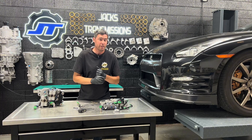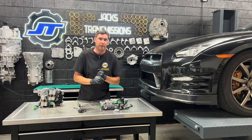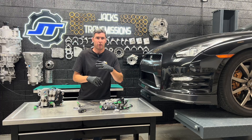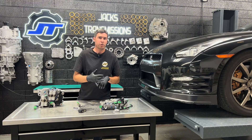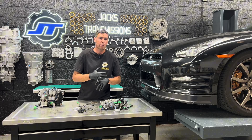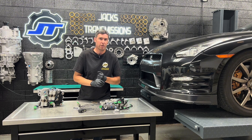It's actually going to look just like this video here, which is this car with a 2016 valve body in it. You'll see that the line pressure is going to go up and then down, up and then down. You're going to hear clicking from the transmission repeatedly as it's trying to force itself to pre-select second gear when you put it into drive. After a while it's going to time out, limp out, and give you an error message with this code.